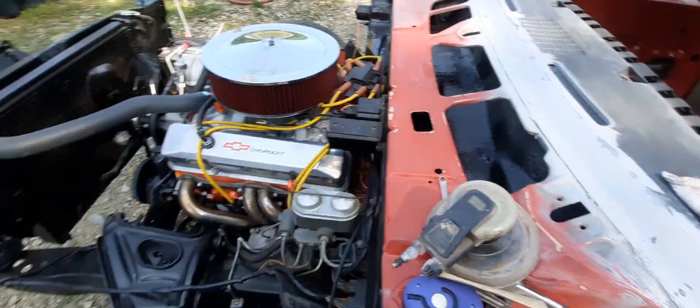Been working a little bit on the top of the dash. You'll see it's still a little bit wavy, so we'll have to do probably one more coat of slick sand on there. Inside the car, we bedlined pretty much the entire floor — it's black inside — sanded it all down to bare metal.